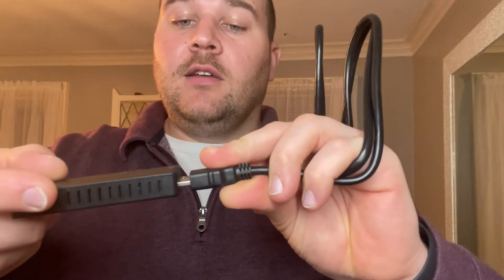You're going to go ahead and plug this end into your Wii or your Wii U, and then this is going to be your converter side. You're going to take your male side of your HDMI cord, plug it into your female side of this converter, and then this other male side is going to go into your television or monitor, and that's going to convert your Wii signal onto your monitor or television.